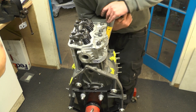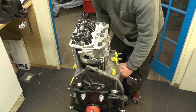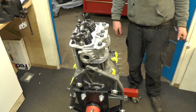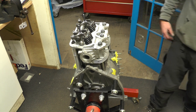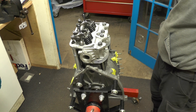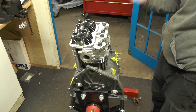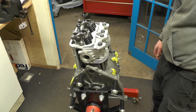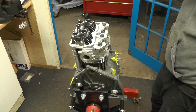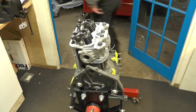As discussed, we could be checking with plasticine seating, but we're not running a high lift cam — slightly higher than normal but nothing radical. This is a tried and trusted combination of parts. Typically if it was outside your comfort zone you'd be checking with plasticine, but you're well aware of your part supply. So now we're just going to give it a quick leak-down test to make sure there are no leaks.